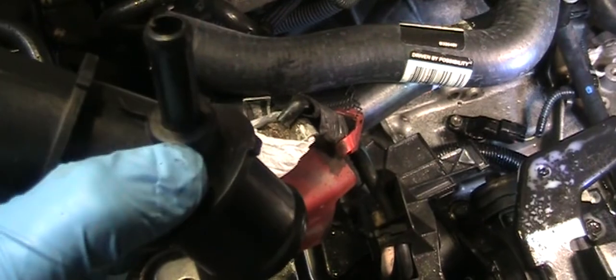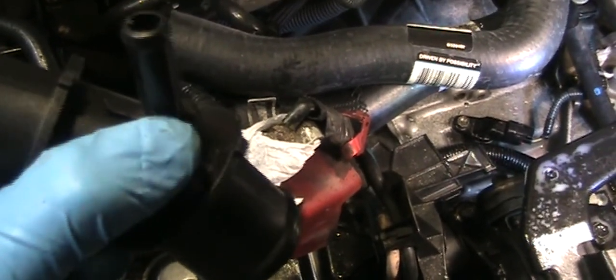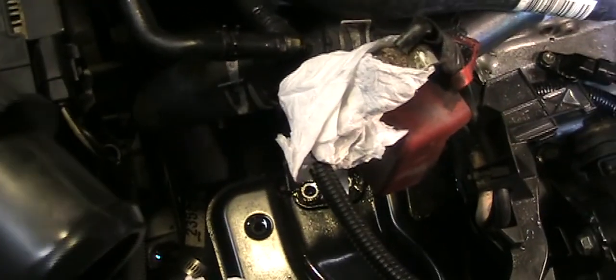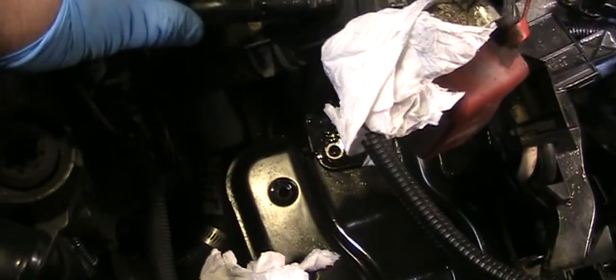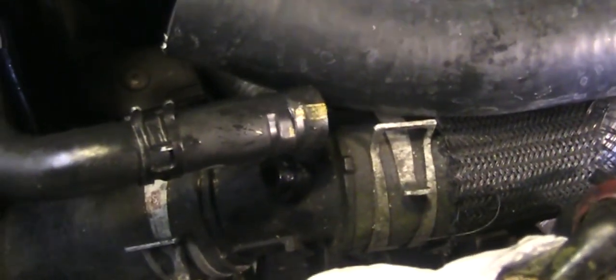I just want to share how I'm replacing this. If you see coolant accumulated at the tip, you should probably order the part and start changing it because eventually it will break. The part is supposed to last a very long time, but once it breaks, you'll find the old part is already very mushy, soft, and corroded.